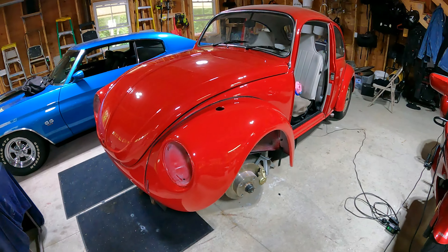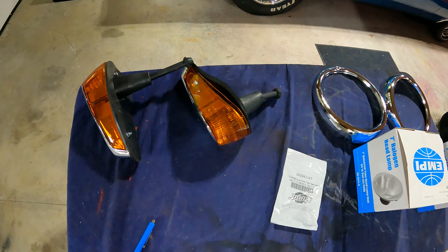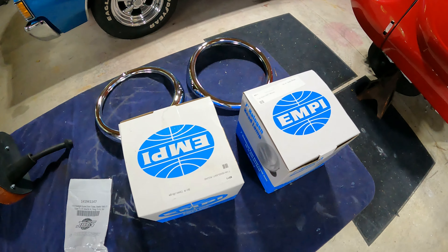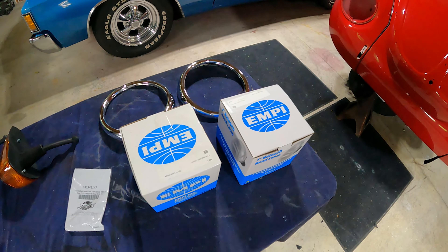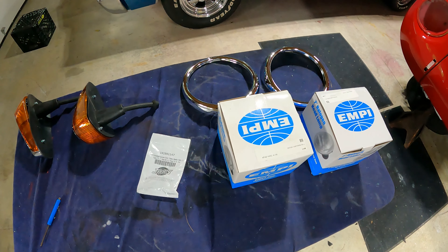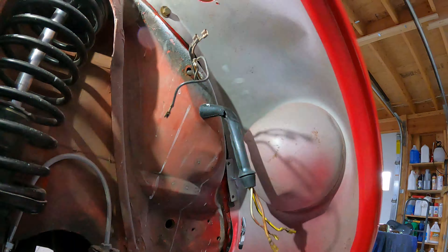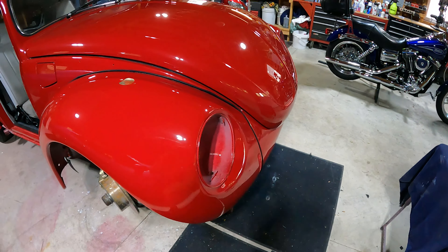We've got brand new headlights right here, brand new chrome trims, and brand new turn signals. The turn signals come with wire looms, which is helpful because the old ones have been dry rotted and broken. We're going with the regular stock headlights — not trying to do any LEDs or HIDs, nothing weird like that. This thing is not going to be driven at night anyway, so the stock ones are going back in. Any links will be in the description. Inside the fenders we have the headlight wiring going through the bucket and the turn signal wiring going up to the turn signal. It's a pretty simple job.